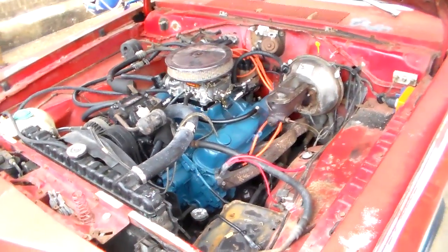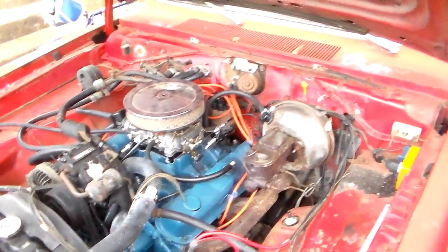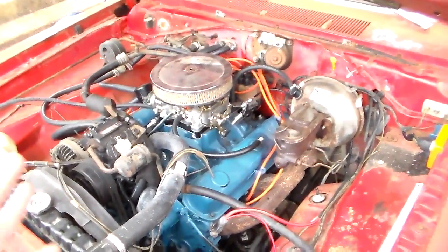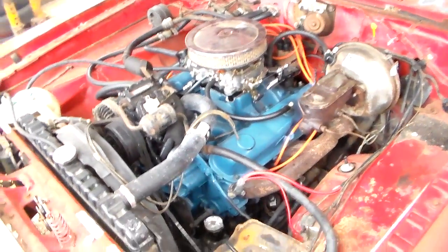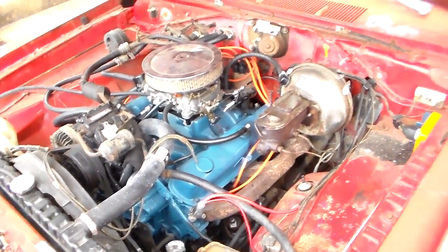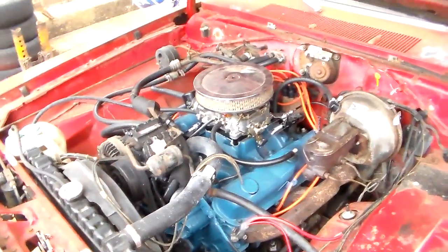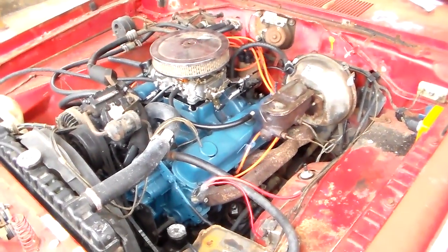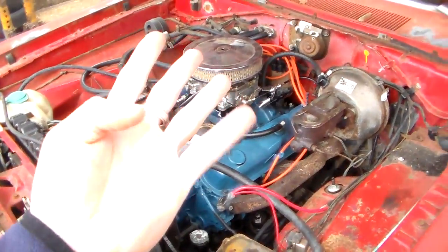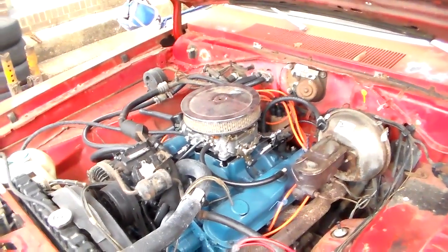Going to change a water pump — especially when you take it off and everything looks good, it may look old, but it's not leaking, the impeller's there, it's not wobbling — then you're wasting your time and money replacing that water pump. I don't know how many water pumps have been replaced that didn't need to be, but people keep believing this. They keep thinking that somehow an all-metal water pump will start losing its efficiency and that has to be causing overheating. That's totally false and incorrect. If it's not exhibiting the three modes of failure I just illustrated, then it's not bad.